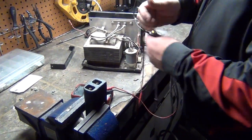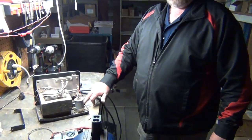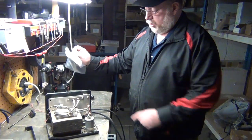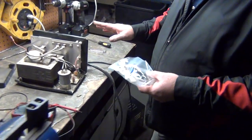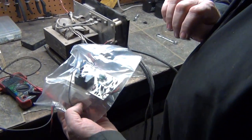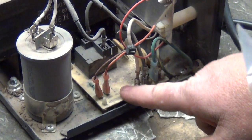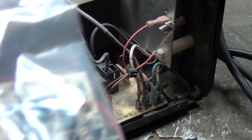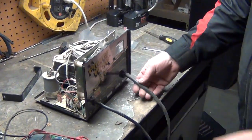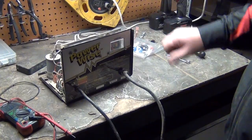Once we've figured all that out, it's just a process of elimination. If the fuse is good and the diodes are good, then it's going to be a board. All the new boards replace this board here. The orange and brown wires on the old style board you won't use anymore — just shove them up, it goes to the board up here, eliminating the old board and going with the new single board. You can take this off, pull it in, clean it up, and you're back in business.